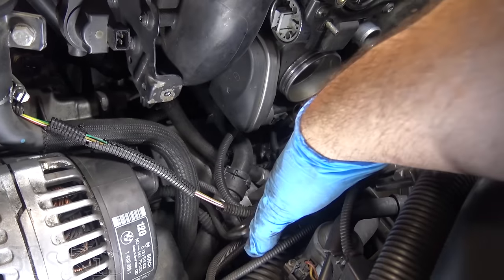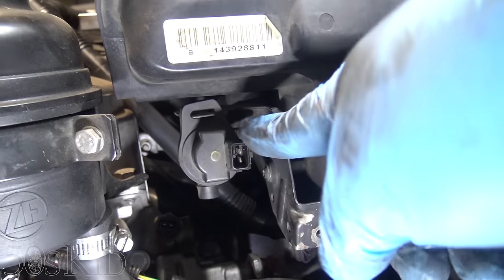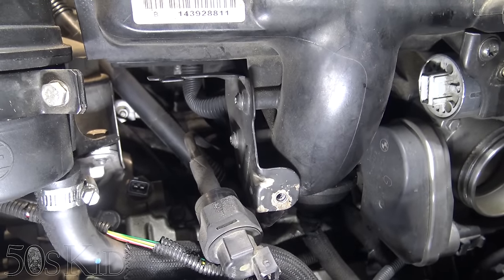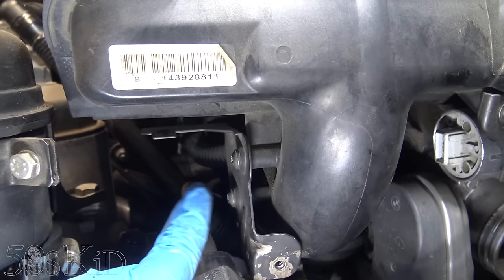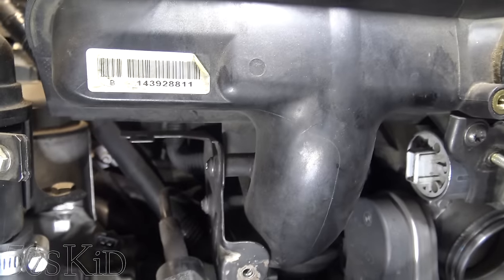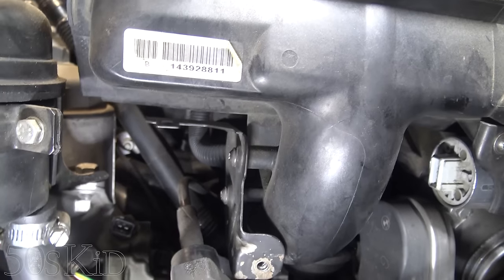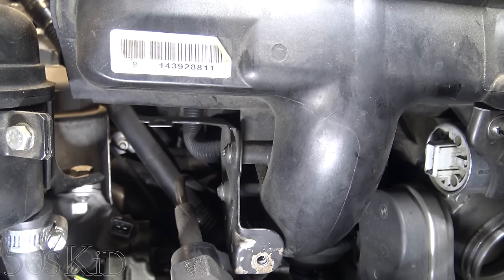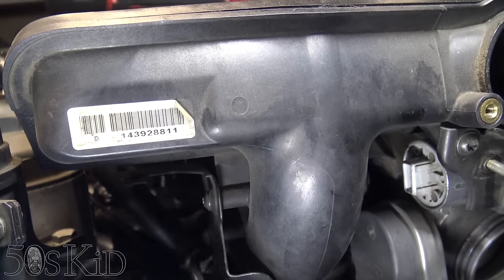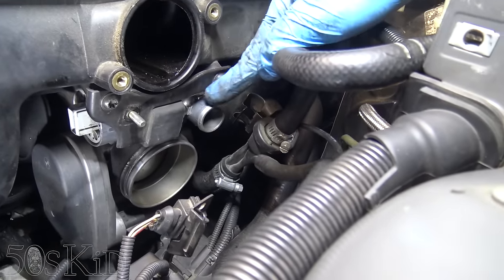This is not all you want to do with the purge solenoid. It's going to be helpful to pull it forward and pull it off of that little mounting tab — that way we're going to get access. You can see this curved tube right here — that's one of the CCV tubes. And that one going at a diagonal right here is also one of the CCV tubes. We need to be able to get our hand underneath here to fiddle with this. This is one of the big secrets of doing this job: you need to pull that EVAP purge solenoid off so you've got access.